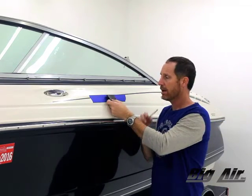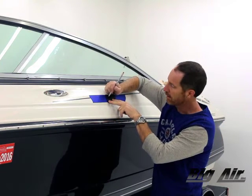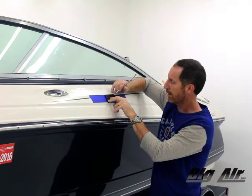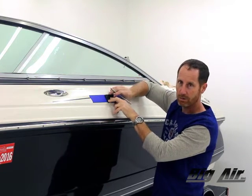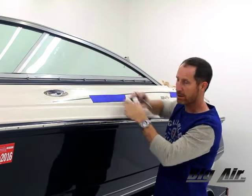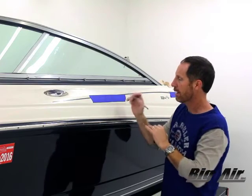I know where I'm at. I've gone in and pre-marked my circle to make it easier for the video. I've got a circle here, and using a bubble level, I've got my other circles right here. A gasket is a great way to lay up against the hole and check it. We leveled them again using bubble levels. I'm going to go ahead and drill through here with a pilot hole and then the three-eighths hole for this particular tower, and then dress it with a stone.